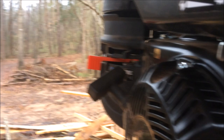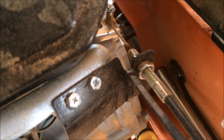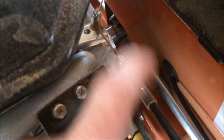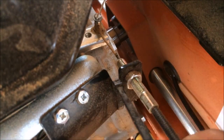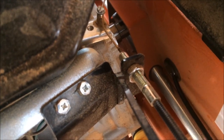One other problem I ran into: if you're not getting a good cut, get your little throttle flipper here. When you run it up and squeeze your handle, make sure your throttle is going all the way in. When I squeeze my handle, I can still push the little throttle — I'm still not quite getting full throttle. You just take the stop nuts loose on both sides, pull the cable back a little bit, run the nuts in, and that'll give you your full throttle. If you're not getting full throttle, that could be a problem.